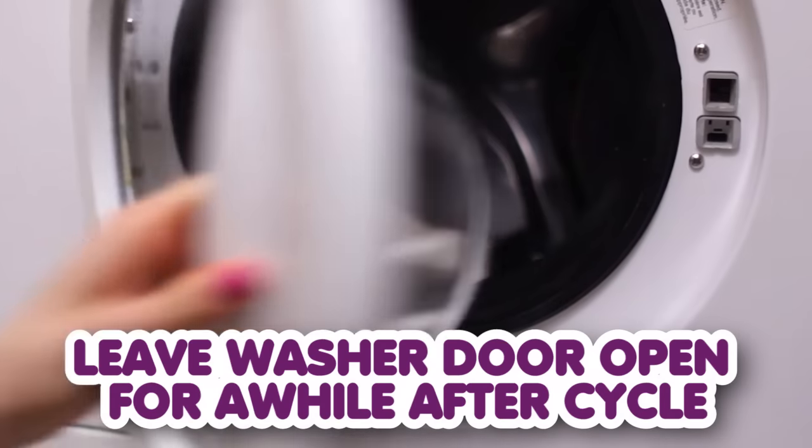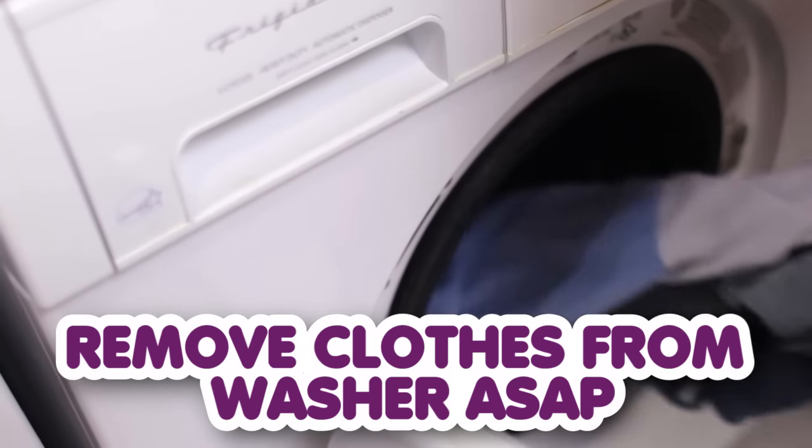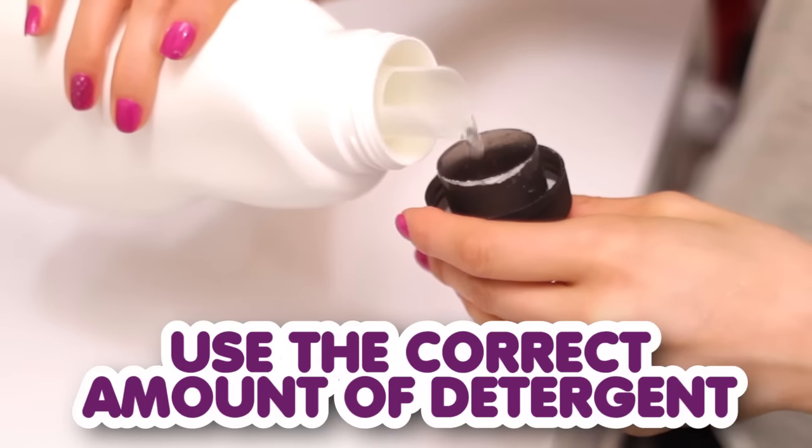Just a few final points regarding your washing machine and taking good care of it. Always leave the door open when you're done with your washing. This lets any remaining moisture evaporate and avoids mold and mildew growth. Also, and I know this one might be a challenge, but try to remove your clothes from the washing machine as soon as the load is over. Same reason as my last point.